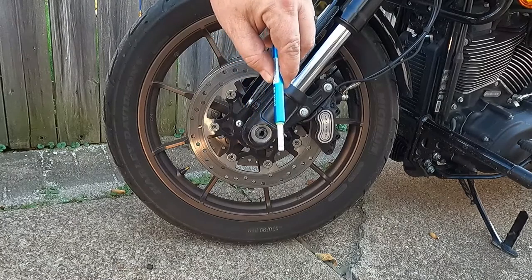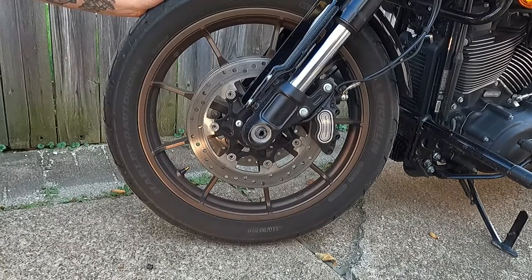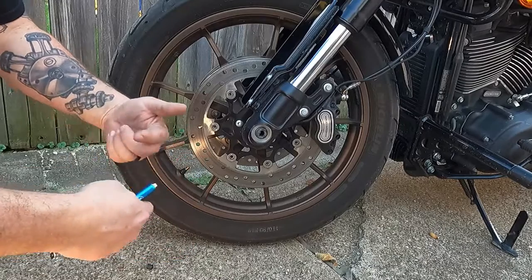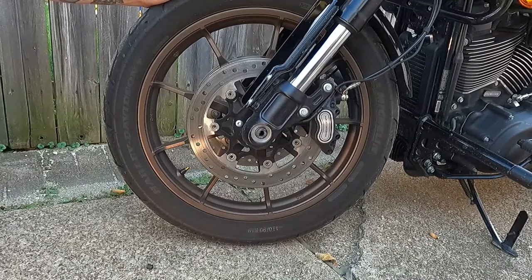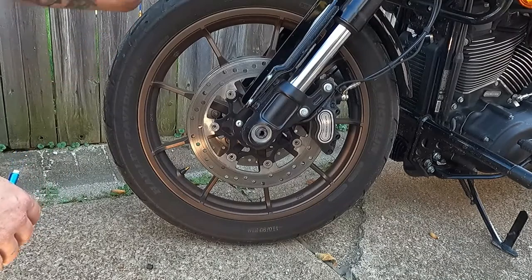It turns out this tire only has 20 PSI in it. That's pretty low. All tires do kind of leak a little bit on their own, and apparently this one has been leaking with the temperature changes outside. If I went out and rode this, maybe it might initially feel okay, but if I really start pushing into corners I might lose a little traction ability. Also the tire could be squishing down and springing back out as it rolls with the load on it, and that can lead to cupping — which is uneven tread wear, a little sawtooth finish down the tread of your tires.